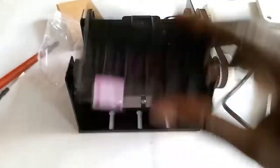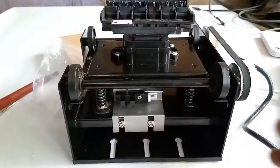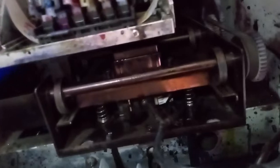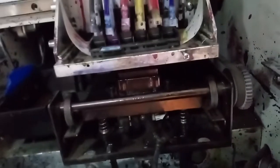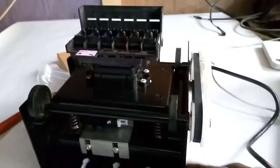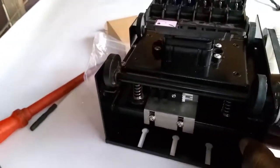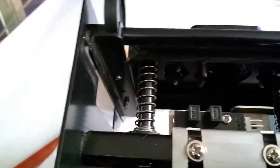In an ideal setup, the printer head is going to be sitting on your cap like this. So basically this is why the capping station was developed — the idea is to find a way to lower the cap, have the printer head move across for cleaning and every other setup, and then rise back up again to protect the printer head when it sits on it. That's basically what your capping station does.